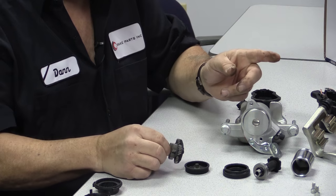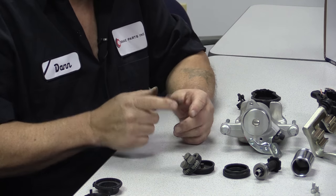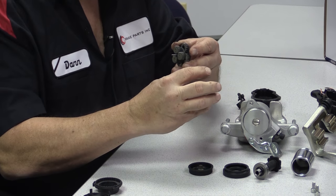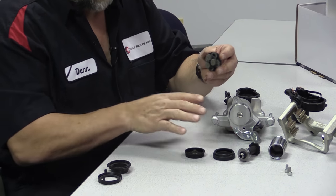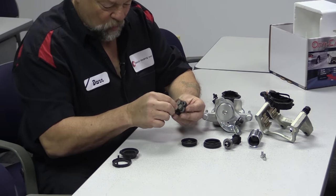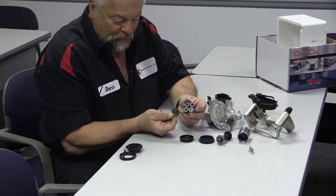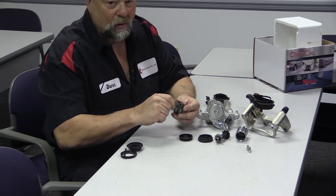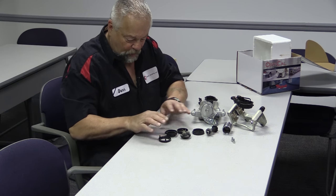If the motor stops turning, the planetary gear set automatically reverses itself. That's exactly how they can run the motor forward and backward without changing the polarity — when it runs all the way and stops, it turns the other way. That's what the planetary gear set does inside. There are a lot of moving parts in this caliper, and remember, this is not an exotic vehicle — this is a basic Volkswagen Passat.